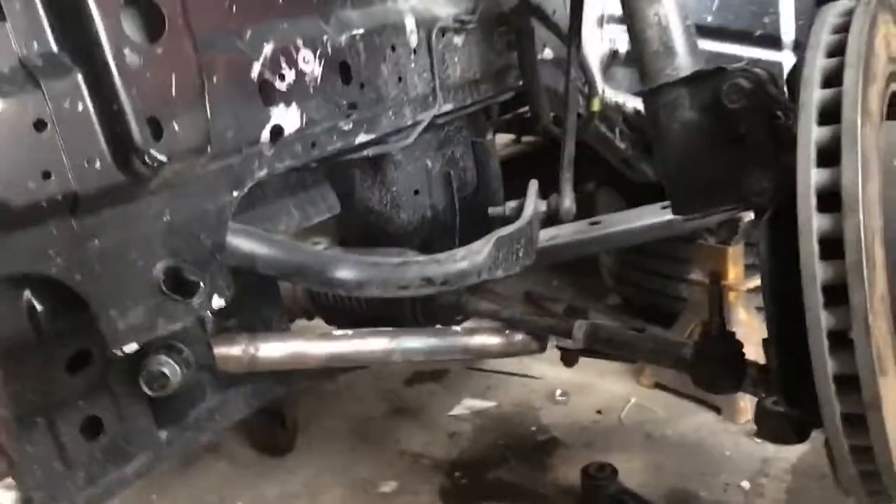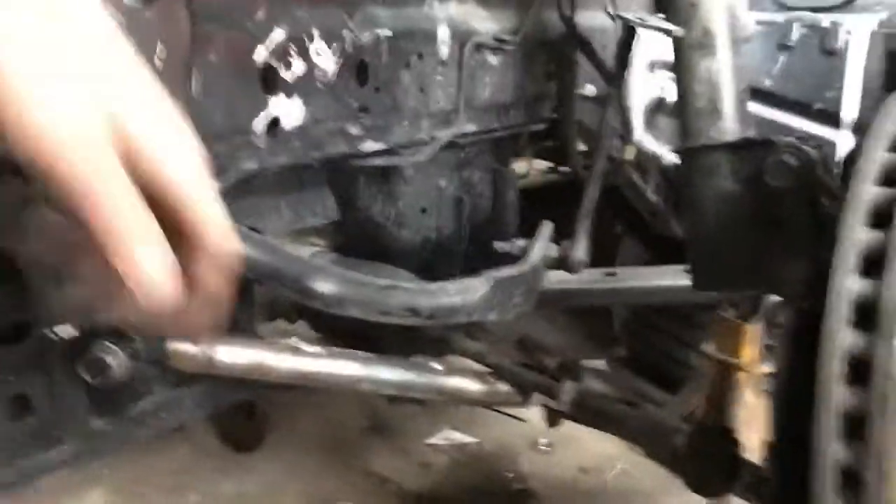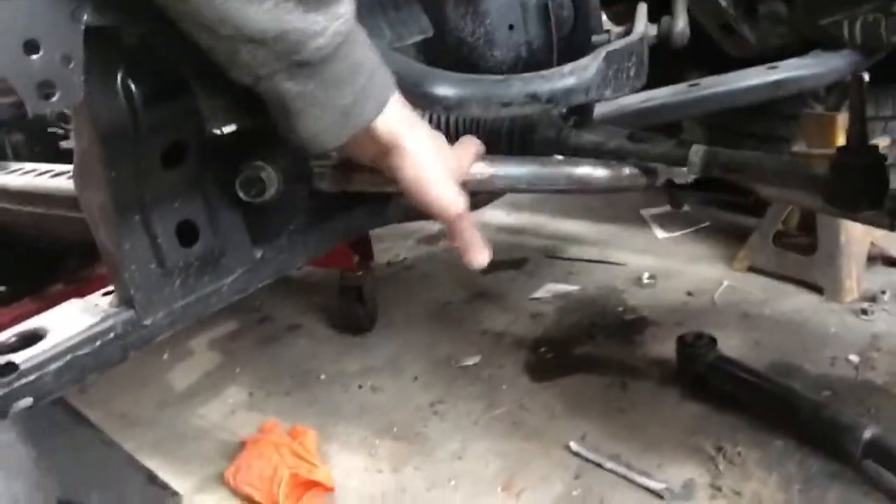I'll give you a little glimpse of what I'm working on. Just know that it's prototype stuff, so I basically took any scrap I had laying around in my garage — spare heim joints — none of the stuff fits perfectly. For example, on the arm I've got a heim joint where a solid rod needs to be; I'm just trying to get measurements and lengths so I can get the correct stuff. As you can see, it's a very similar style to the GTO — a single lower arm with an independent radius rod.